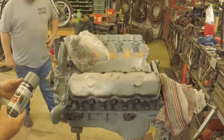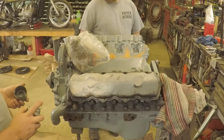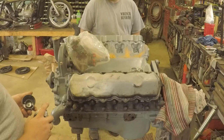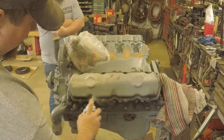As far as engine paint goes, I do like to use engine paint when I paint a motor — it's designed to be on there, so it will have the best results with temperature and everything else. The only time I really worry about using really high-temperature stuff is when I'm doing exhaust headers, manifolds, that kind of stuff. Most paints you find at a parts store have different temperature ranges labeled on them. This is designed to withstand heat up to 500 degrees — this is engine paint. It is actually classified as Ford gray, but these were gray in the eighties. This is international gray — that was in the engine block of the trucks. The valve covers don't see a whole lot of heat.